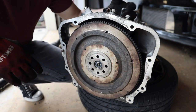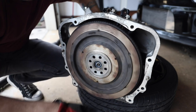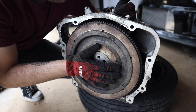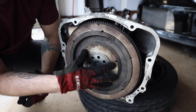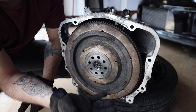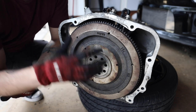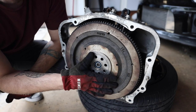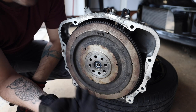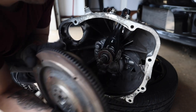Like so. So now this way, whenever I can't compress that spring with my hand, I don't have any upper body strength to do so. So that's kind of how it all works together. You press in the clutch, it hits this clutch fork, which then pushes on that throwout bearing, depressing those diaphragm springs, releasing the clutch from the flywheel. When it's engaged, obviously you're not pushing on anything, but the clutch is pushed up against the flywheel and spinning with it, which in turn spins the input shaft and the counter shafts inside of the transmission, which then sends power to your driveline, to your rear differential, and that's how you get all those awesome chooching noises and make all the power. So, it's a very heavy assembly also.